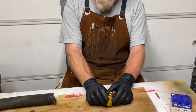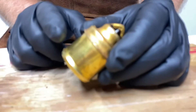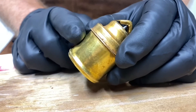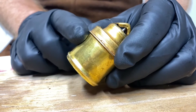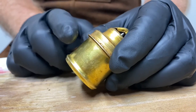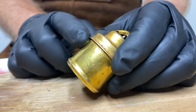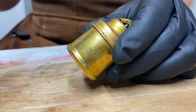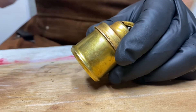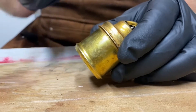There's less chance of decreased wear in your engine and it's going to be more fuel efficient — the tractor is going to run better for you. This is a 160 degree thermostat, so basically when the coils in here reach 160 degrees, this thermostat begins to open. It's not fully open at 160 degrees — it just starts to crack and begin to open. I think at 180 degrees this thermostat will be wide open, allowing water being pumped through by the water pump to go through the whole engine for proper cooling.